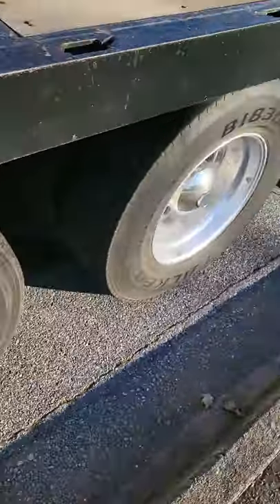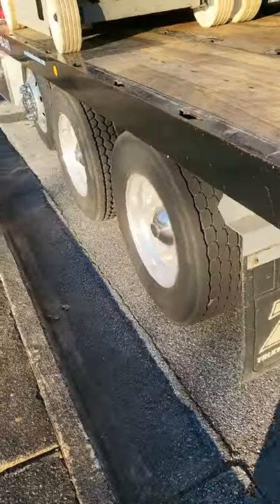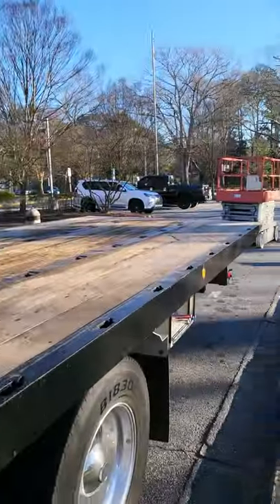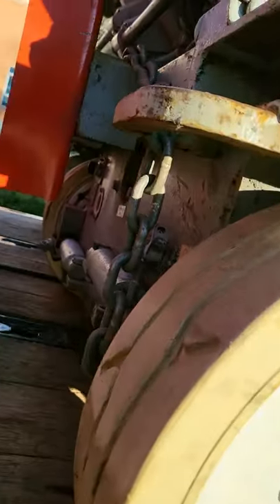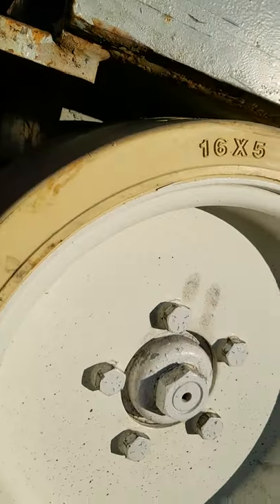I'm going to put another 10-foot chain in the rear and secure these two units I have on the truck before I tilt the bed to load up that third one back there. This is my interpretation as I see it. I got the bed very close to the cab — I may have to slide it back some so I can safely chain down my binders.